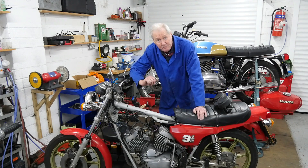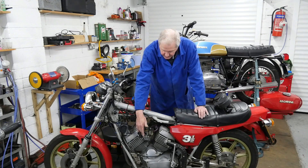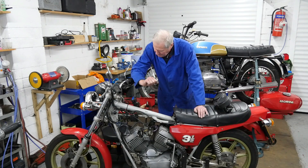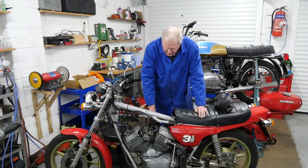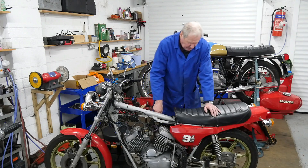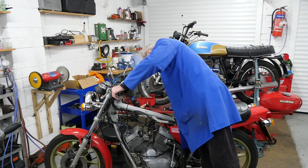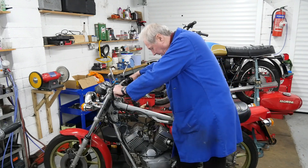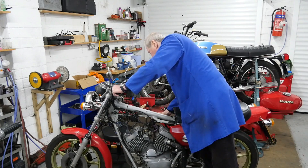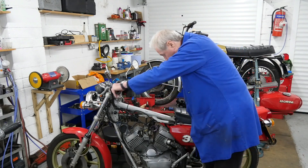Now, as a matter of interest - there's no tank on obviously - I'm going to fire it up just briefly. Because it ticked over fine before: on tick over the two slides are in the right place, adjusted on the tick-over screws, so the idle was hunky-dory. It's when you ran it you had an issue. I'll put the choke on - obviously no petrol going in, no tank - give it a little ignition, give it a boot and we'll see where it leads us.